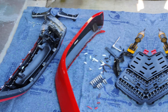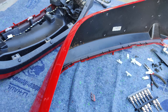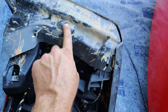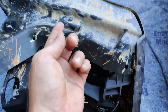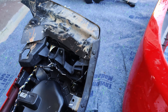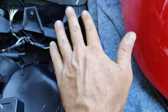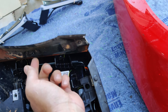Another check-in on the fender trim removal. One side is all done. For the other side — still fresh off the vehicle — you need to remove this tiny little Phillips head holder, which is super flimsy. Then there are several T30 bolts: one here, one there, one down there, one in this corner, and one back behind the trim piece. Make sure you get all those T30s out before yanking on anything.